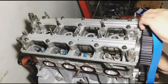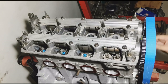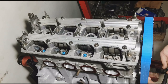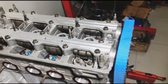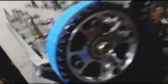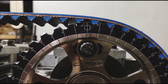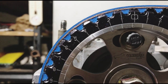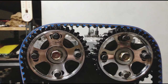And now the Gates Racing timing belt — thanks, Ed. We're gonna get it snug and installed properly. Now you can see the rocker arms move. After turning it, here we are. You can see on the cam gear it's zero on the intake and plus two on the exhaust — just how we did the valve-to-valve. You can click here for that video.